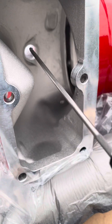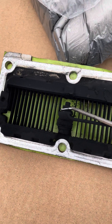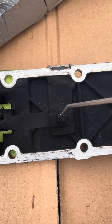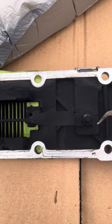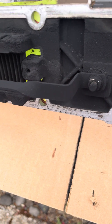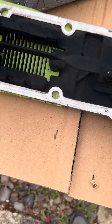You can see the whole throat, and all of this is wide open — a bit taller, long radius — to get a little better airflow. This is the infamous death bolt. These have been known to corrode, break off, loosen up, fall off, and fall inside the plenum down into the back cylinder. Ouch. So that was kind of my basis for doing this originally — to not have to worry about that bolt coming loose or corroding and falling off.